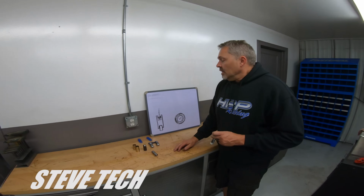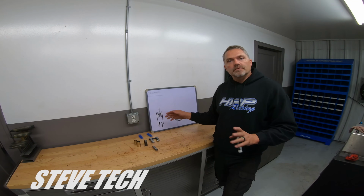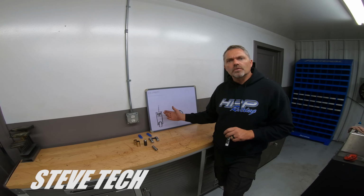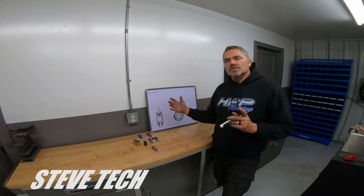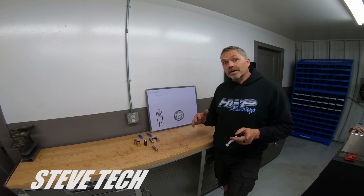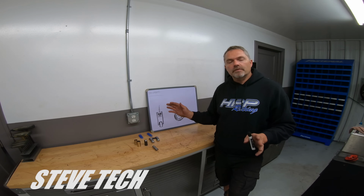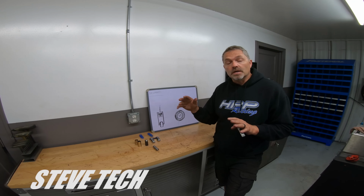All right. So there's a bunch of information out there you can find on hydraulics, pretty common stuff. You are going to find that in really good race engines, hydraulics are pretty much converting everything over to a limited travel. The only reason we're even using a limited travel hydraulic or any type of hydraulic is purely noise. That's it. Just noise. People don't want to have any kind of clatter, light clatter, especially in cars with good exhaust.